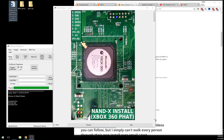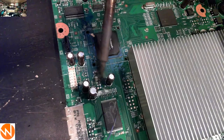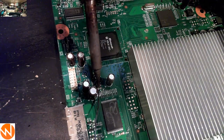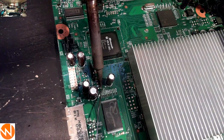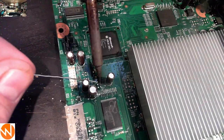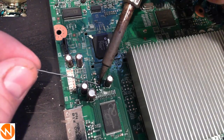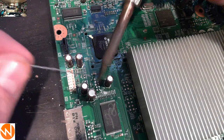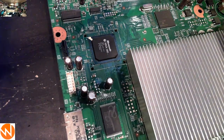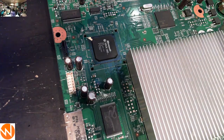Referencing back to the diagram, this header has black, brown, red, orange, and yellow going down, then green and blue going up. Watch me solder these connections exactly like that. Technique is key — I can't tell you how many motherboards I've seen killed by not doing this properly. We've got our flux paste; we'll hit it with the soldering iron, spread it out a little, and place a small ball of solder on top of each pad — this is colloquially known as tinning the pad.